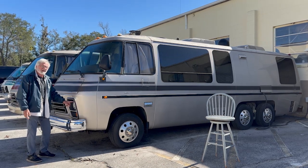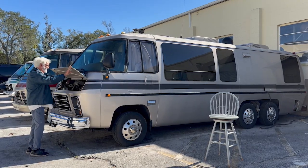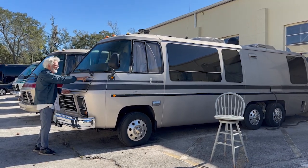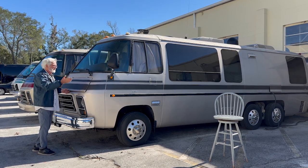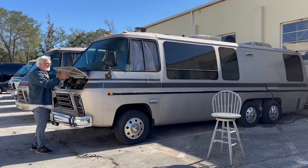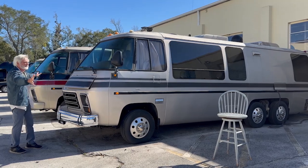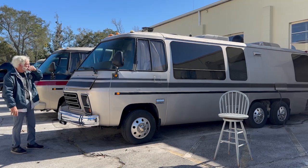While the bumper is off, you might want to skin it and paint it too. On '73 models the front hood hinges were metal, but on '74 and after they're stainless steel — take those out, put them in paint stripper overnight and they'll be beautiful; you can even polish them. Paint the hoods at the same time: clean and paint the bottoms first, then paint the front of the coach with the hoods in position so the angle, pressure, and mix all match.